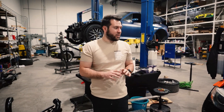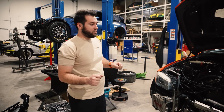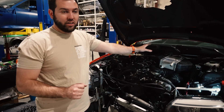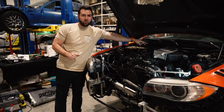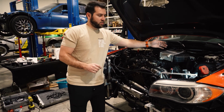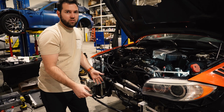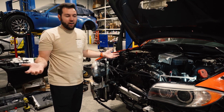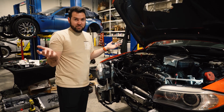What little plastic pieces are going to get in the way, I have no clue. Will we come out with a kit? Probably not — but I'm here to tell you how you can do it yourself. Realistically, with this whole side being plug-and-play, any shop can weld the turbo to the two holes. It's just basic welding, some AN fittings, mounting a heat exchanger in the front, and plumbing three lines to the water pump and heat exchanger and back. I honestly think anyone can do this.